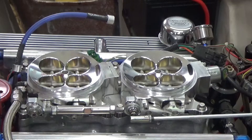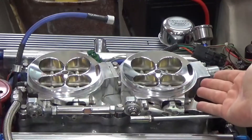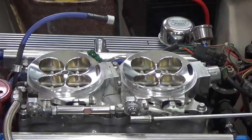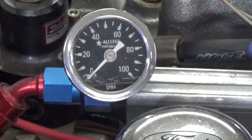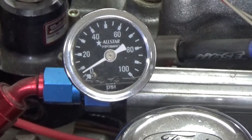So let's troubleshoot those and see if we can figure out what's wrong. First things first is air — I have tons of air, there are no restrictions, the air cleaner is off, so air is getting in. Let's check the fuel. I can turn on the ignition to make sure I have fuel pressure. Alright, we got fuel pressure.